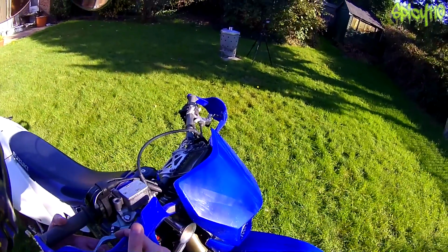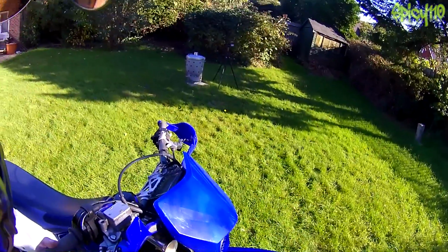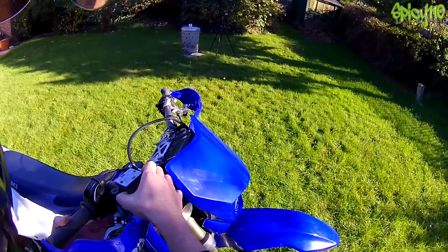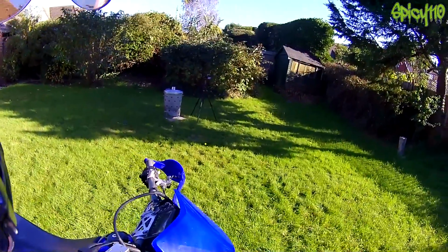So yes, brake fluid is very, very important, and if you come around to changing your brakes and your pads, change your fluid at the same time. Just do it. It's not too expensive. You use a tiny amount here and whatever's in the line.